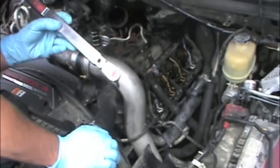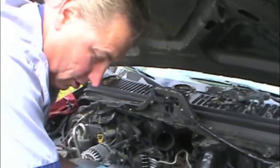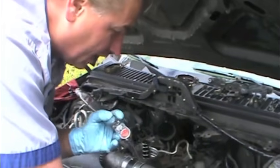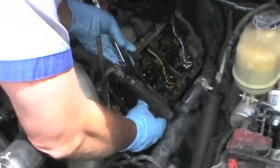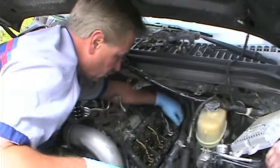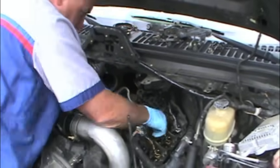You would want to start them by hand and drive them down by hand. Another bit of advice: torque these down. If you just snug them down — when this came out in 03, we were getting comebacks from them backing out or the hold-down bolt on the fork breaking. So you can over-torque them and you can under-torque them. But if you use a torque wrench and torque them down, you don't have a problem. There are also different years with Torx 40s and some with Torx 45, so look it up. If you get somewhere around 26 to 28, you're not going to have an issue — it's not critical, you just can't be too tight or too loose.